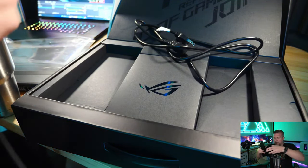That's nice. These little foam things are also interesting. They actually help route the air. Basically, the bottom of the chassis presses against them, and it helps route the intake of air. So I'm guessing this helps prevent taking in residual warmer air, and so it just takes the fresh, cooler air from the outside. I like this. It's a nice little extra touch, and I'm sure that helps improve the thermal performance of this laptop just a little bit more, having these little foam rests.